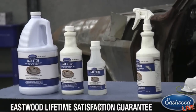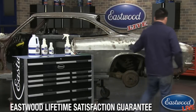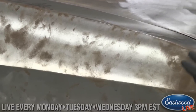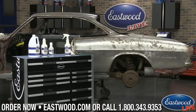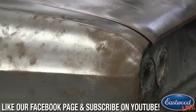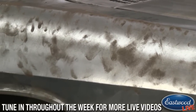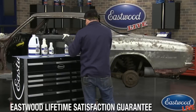What we're going to do is we have Mark's Corvair here, and this is a perfect example of a project I've been working on for a while now. You can see it was stripped with the SCT, but just from moving the car around and touching it, the oils on the hands of anybody who's touched it has caused surface rust all over. I'm going to put all my safety gear on — definitely want to wear safety glasses or goggles. It does have a little bit of a smell, so I'd suggest a respirator or at minimum a dust mask when you're spraying a lot of it.